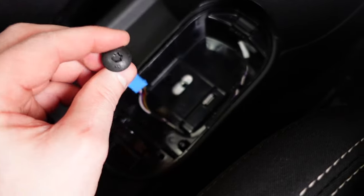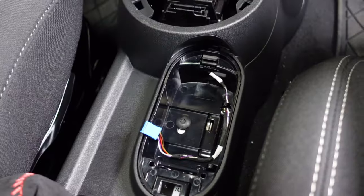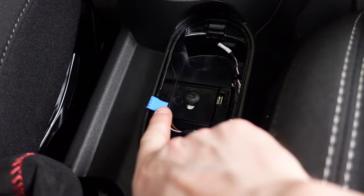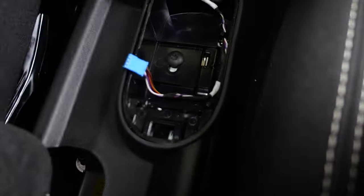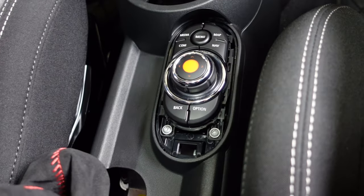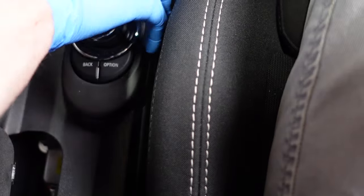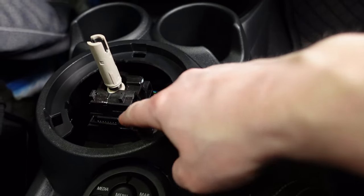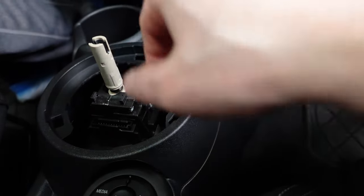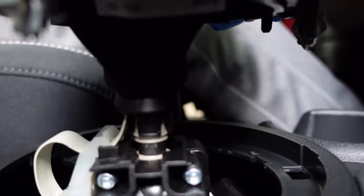With the front screw back in, pop the kick panels back into their clips — just a quick push and you'll hear them snap into place. Before reinstalling the iDrive, put the T30 bolt back in underneath the iDrive controller to hold the center console down. Once that's tightened, plug in the iDrive wiring harness, slip the front under the metal clip, put the two bolts in the back, then snap the trim ring back into place — it only goes one way, clip at the back, slide in and push down. For the gear selector, plug the clip back in, put the wiring harness holder back, replace the boot, and push the selector down until it snaps into place.